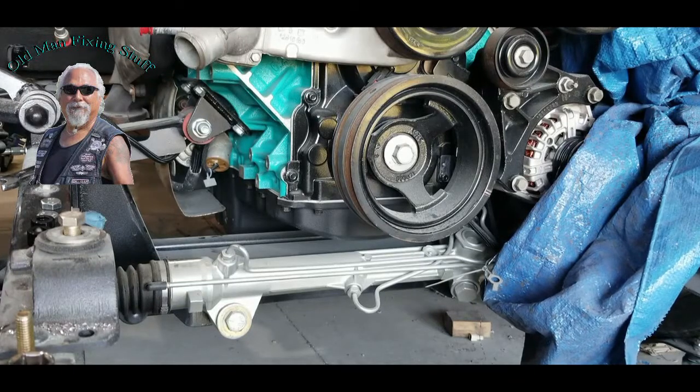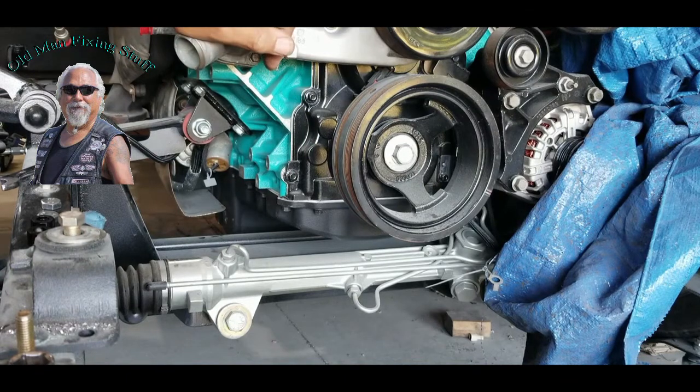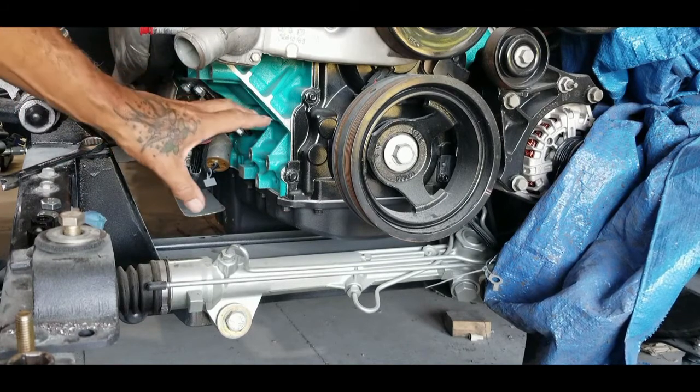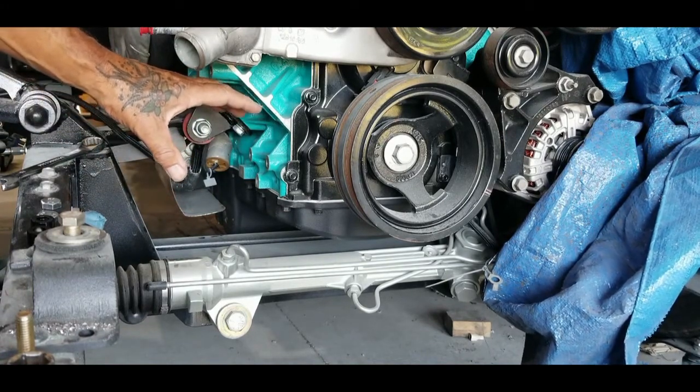Okay, so I'm working on the lower compressor mounting bracket. I'm putting in a Vintage Air AC. I'm using all the factory mounts that come with a regular LS3. The only thing I'm doing different is, since I'm going with a Vintage Air setup, the lower bracket here is different, and that's where my air compressor is going to go, right